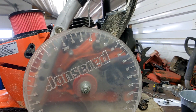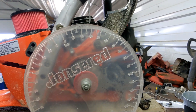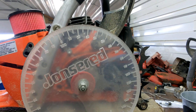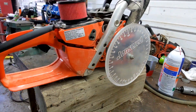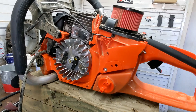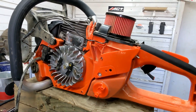I did have this all the way out to about 32 degrees, and it just popped, banged, and wouldn't rev right. Like I said, the ignition advance on these stock is very aggressive. We're looking at about 27 to 28 degrees stock ignition advance on the CS7310, which is very aggressive. 25 to 29 degrees on a work saw is about where you want to be. That's a little bit on how I check the timing on these things and make adjustments for repeatability of performance. Thanks for watching.